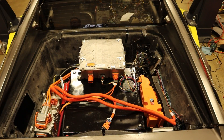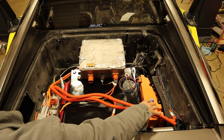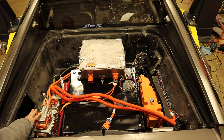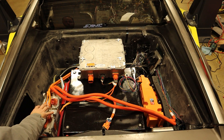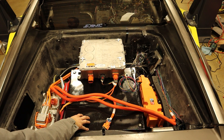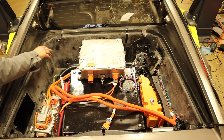Starting here at the back of the vehicle, we have the rear battery box — the large black box here — and it contains half of the batteries. Mounted on the right side in that orange piece is the contactor box, which handles turning the high voltage system on and off for the whole vehicle. Then here on the left we have the high power distribution module, mounted to the frame and connected over to the contactor box. It allows us to send high voltage to all of the subcomponents. The charger module handles AC charging from a wall socket, converting that AC into DC that the battery can use. Under the charger, here in front of the battery pack, is the inverter — also known as the motor controller — which converts the high voltage DC power into three-phase AC power that the motor can use.